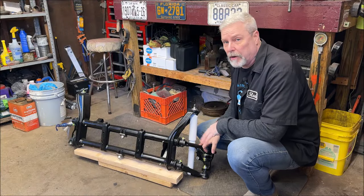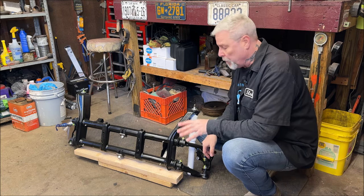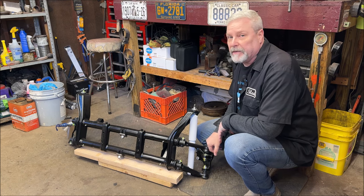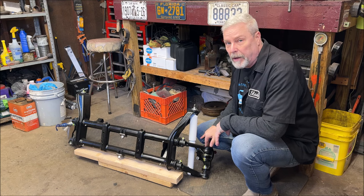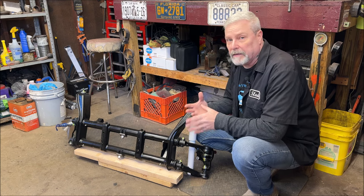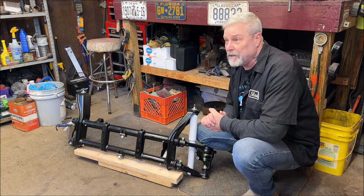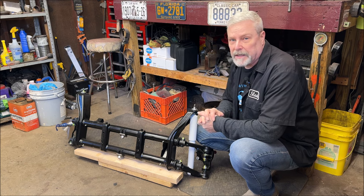And these control arms, just like any other ones, don't come with grease fittings. I'm not gonna do it today. I won't bore you with that. But I'm gonna tap and put the grease fittings in the ball joints and tie rod ends so that you can lubricate them also and you won't need tie rods and ball joints every couple years. I already did a video on that, so I don't know if you wanna see it again.